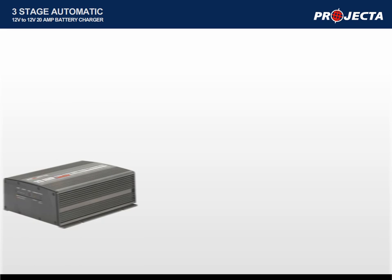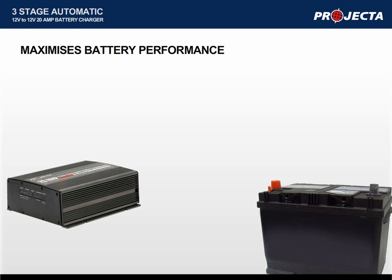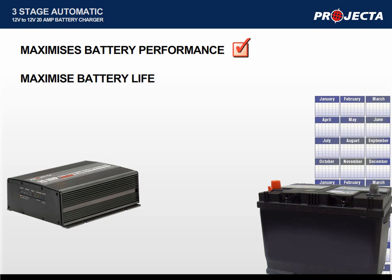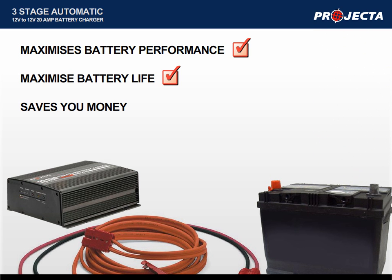The main advantages of using a DC Battery Charger are: your auxiliary battery will run longer, ensuring you get the best performance; batteries will last longer, saving you money on replacing expensive deep cycle batteries; this reduces the need for heavy and expensive copper battery cables; and it allows you to use deep cycle batteries for auxiliary power.